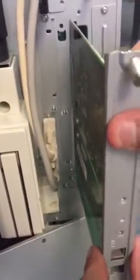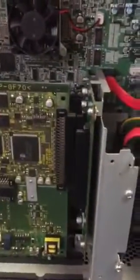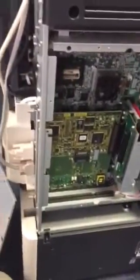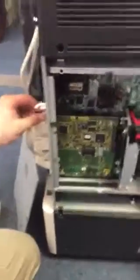Go around to the side. You're going to be sure to remove the plate from the front slot, and you're going to see little grooves on where the board's going to sit and there's a little track on the bottom. It's going to slide in and make a connection. Like John's doing, use the back for support. Once you have it in, it should sit flush at the very front. If for some reason it's not sitting flush, take it back off and reseat it. Once you have it in, you've got some little hand-tightened screws on the front, top and bottom — just finger-tight.